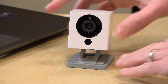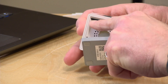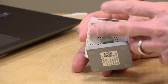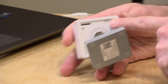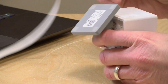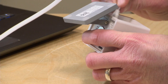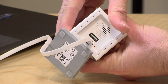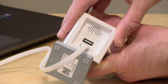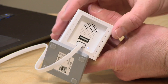The card slot on the regular Wyze Cam is on the bottom. Stick the card into that slot — sometimes you really have to push it in far, so using a screwdriver to help engage it can be helpful. There's a reset button on the camera: hold that button down, then plug power into the back. You want to watch for the orange light to turn blue, which means the firmware is being written to the camera's ROM. This might take about three to four minutes, then you should have a webcam.